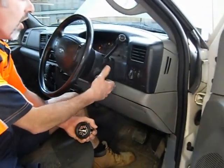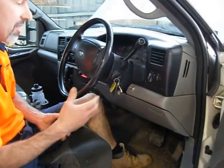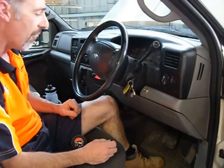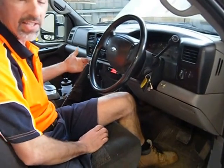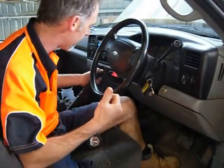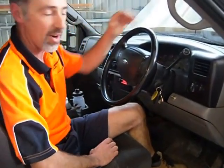When the ignition's on, the compressor runs the pressure in the tank up. When it gets to its set pressure, the 12 volt compressor turns off. Interlocked to the handbrake is the maxi brake on the trailer, so it wastes the air out of the truck and the red line going to the trailer. When we put it back down it charges the trailer for driving off.